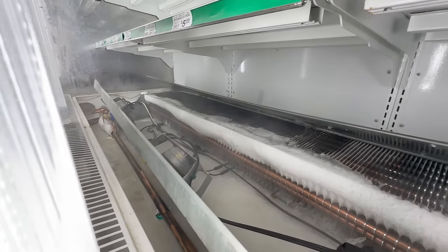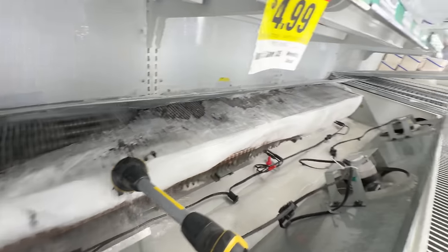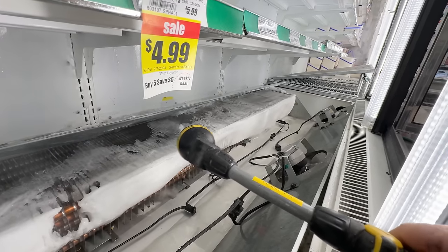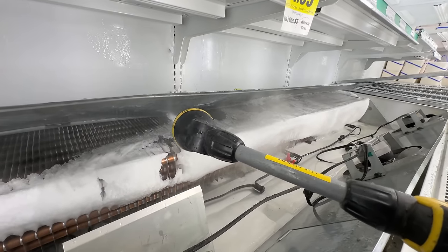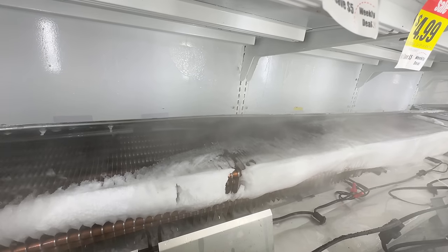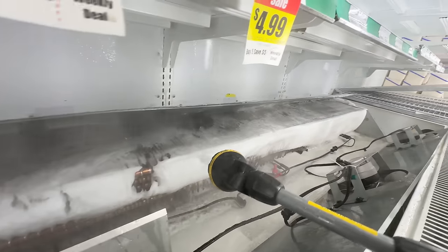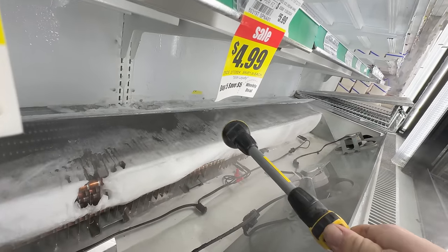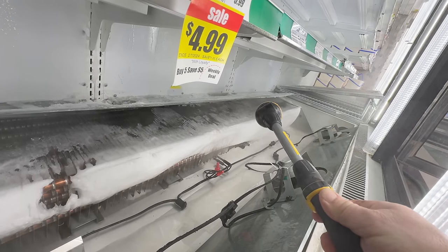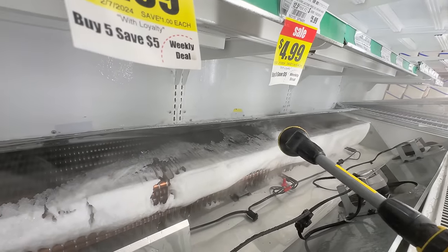As you can see, most of that ice is superficial and it's towards the front, which is a good sign. So we'll go ahead and get this thing melted out. The big thing is making sure you've got it all the way in that very, very back corner. If you don't get it all the way out of that very back corner, that'll cut the airflow off and it will come right back again within a short period of time. And you'll be back doing this all over again — this is not something we really enjoy doing.